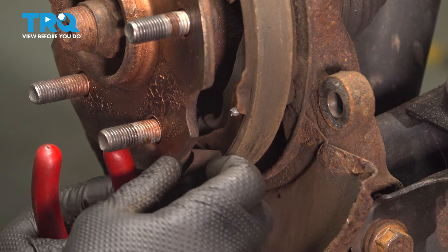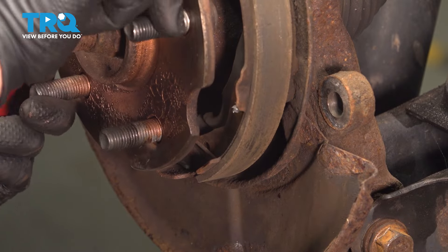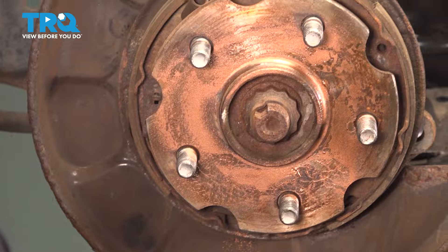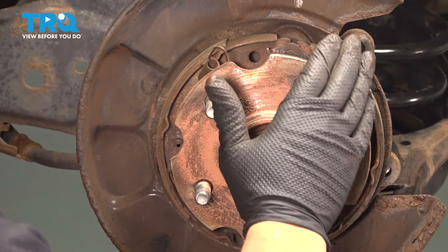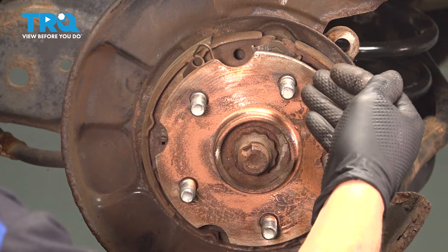Take those out, and there's one on the other side at 9 o'clock. The other side top spring fell out, but what I always do no matter what — I've been doing this for a long time — I still set up the springs the way they were set up in the brakes, away from the car.